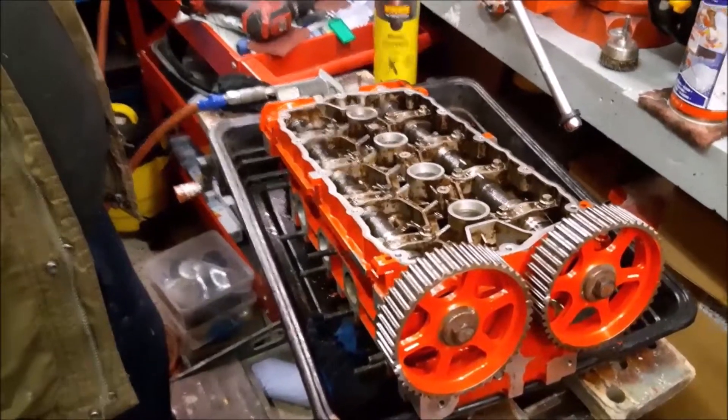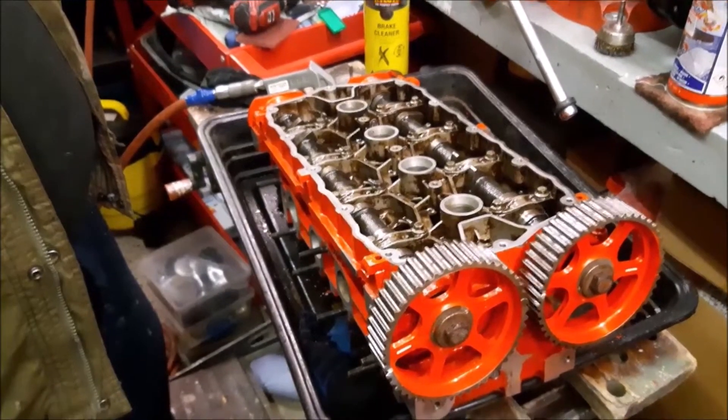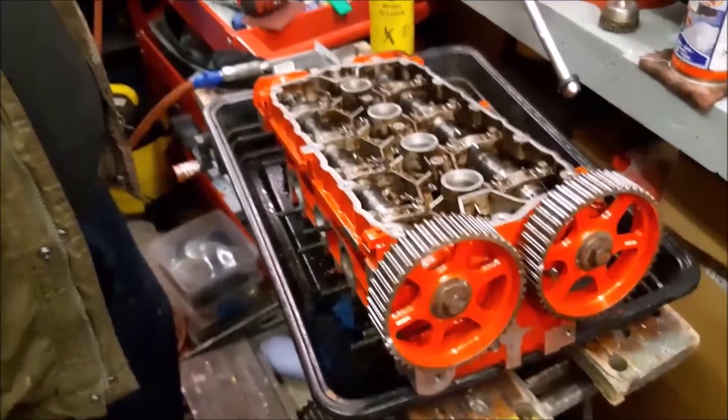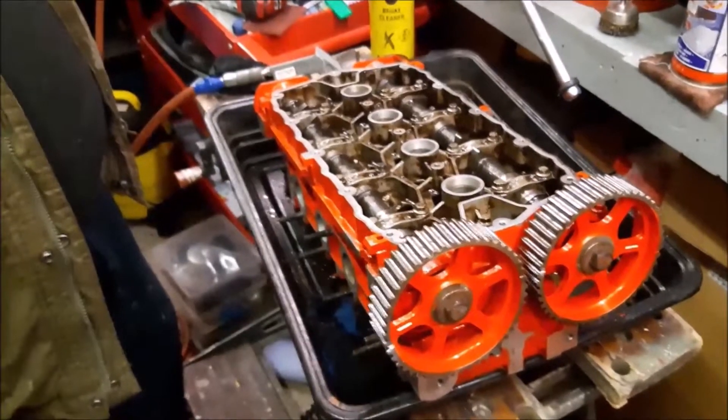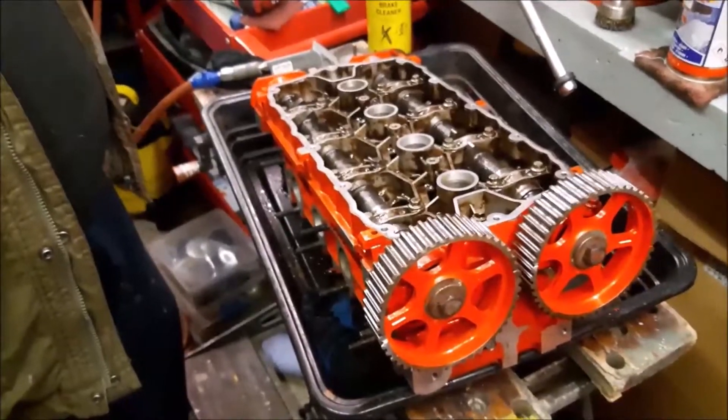While we're doing this, I thought it'd be a good opportunity just to have a look at the camshafts actually moving. This isn't something you'd do when the belt was connected, but because we've got the head off and we're cleaning it, we've had to turn it, and we'll have to set all the timing back up when we put it back on.